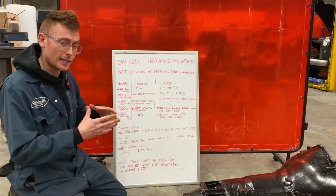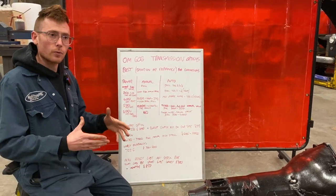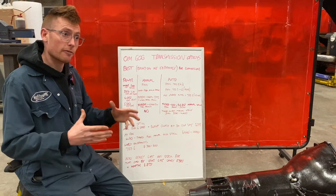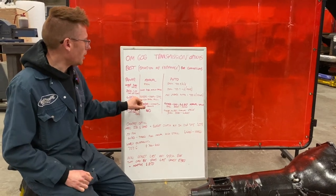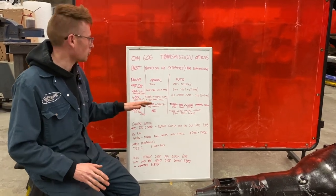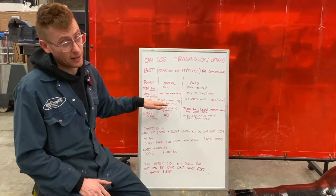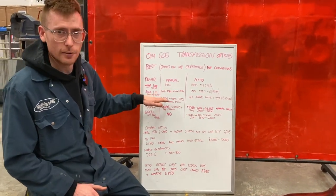The CD009, which is a Nissan 350Z, again with an adapter kit. The 37DZ, which is the smaller BMW ZF, is really strong. And the 3.0 and 4.2 Nissan Patrol transmissions will take that kind of power — they're really strong. That's really the only stock application at this level; the others will obviously be a conversion. So if you've got a 124, you'd use a 37DZ because it's a small, neat fit.